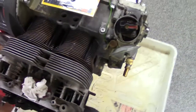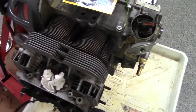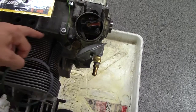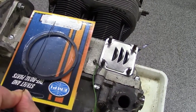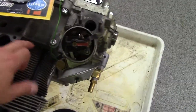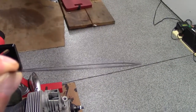The next thing I need to do is take off the cylinder head — there's eight bolts or whatever — then slide up the cylinder, take out the wrist pin, take the cylinder and piston out together, clean the base of the cylinder and the case, and then slide these shims in. These are 20-thousandths spacers. What's amazing is these are paper thin — you wouldn't think this would have any difference on the running of the engine, especially when you consider if you're using paper gaskets, which kind of disintegrate, or any Permatex or sealant, you're probably already getting at least 10 thousandths of thickness.